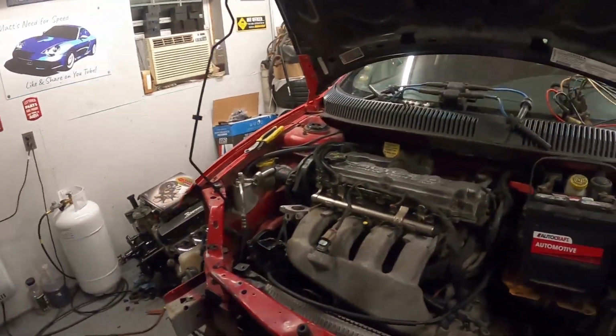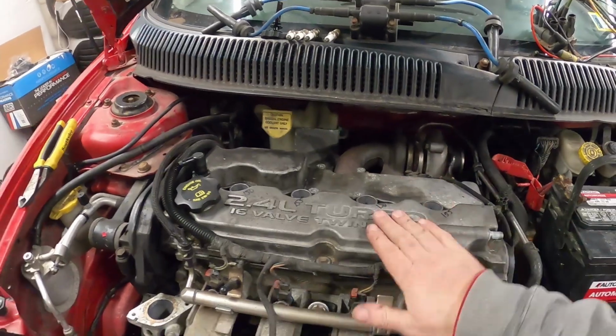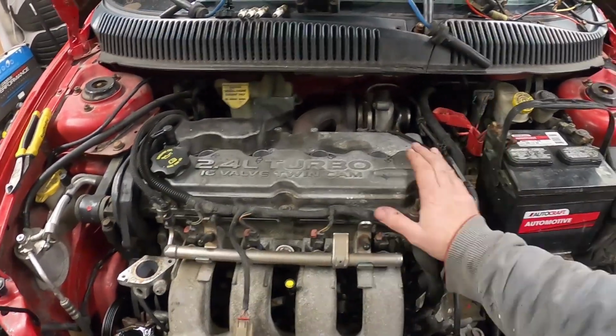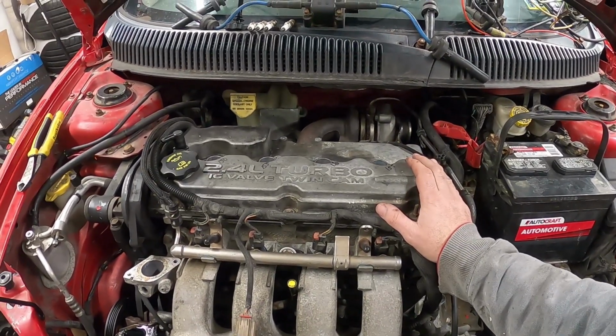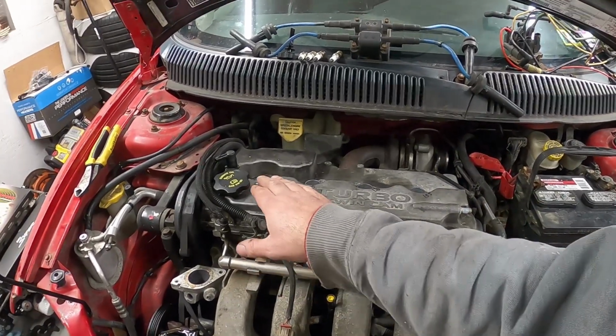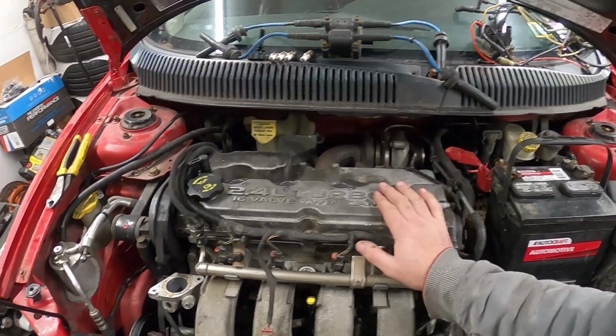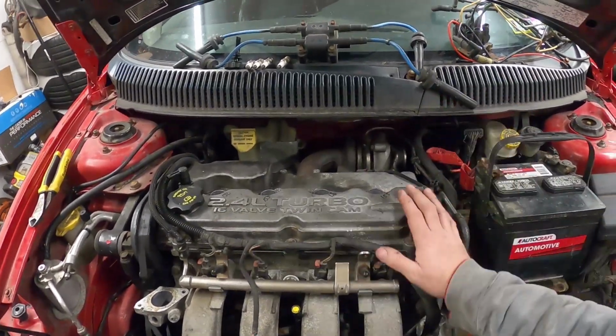So anyway, that was a real quick compression test. We had 155, 150, 155, 150. You might as well just say this is 150 across the board, give or take. I'm sure I could go through here and do three tests on each one and get an average, but they're all going to be right around 150.